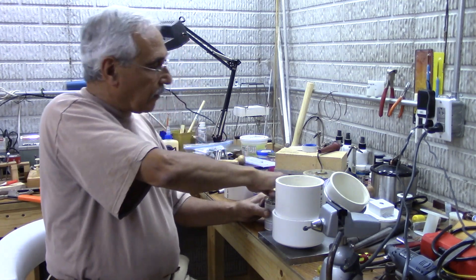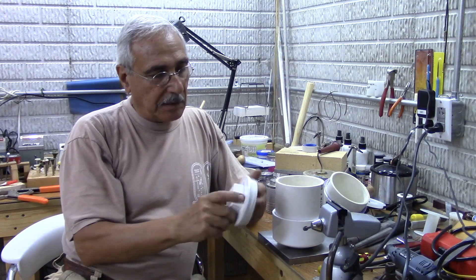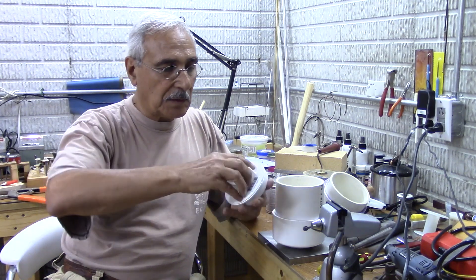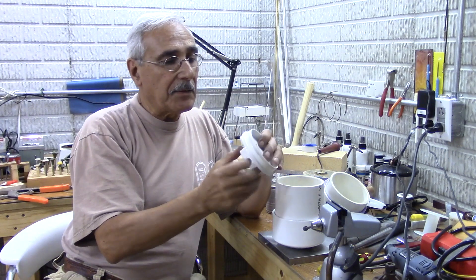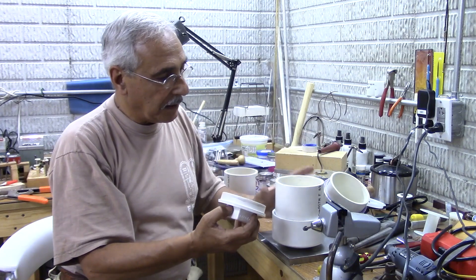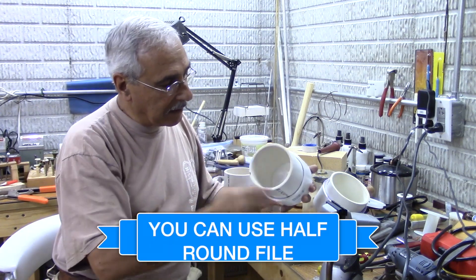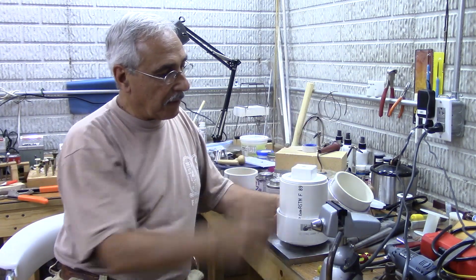For the cover, I bought another fitting which was threaded — it was made for closing off or gaining access to something. What I did is I machined off all the threads on the lathe and reduced the diameter slightly to fit the pipe. I also put the pipe on the lathe and gave the tip a small chamfer so the cover fits on nicely.